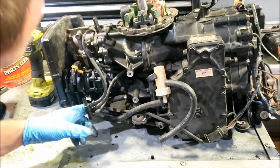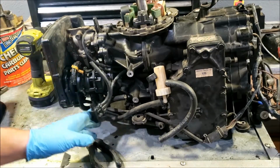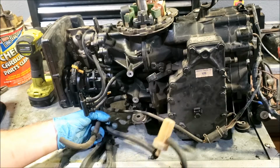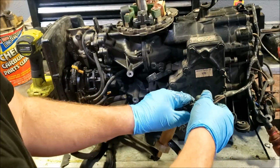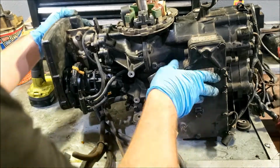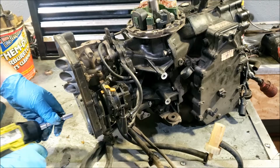Alright, so that disconnects the VRO pump from the rest of the thing. I think in, oil, and then out is all disconnected. I'm going to disconnect the electrical connector. Now, this VRO pump isn't going back on here. I'm going to run a traditional fuel pump.